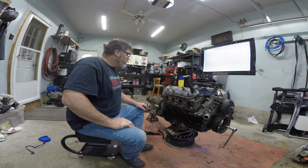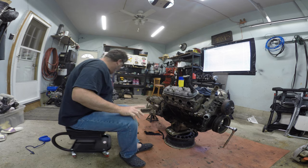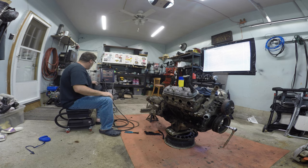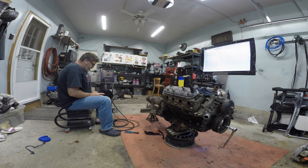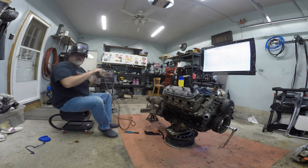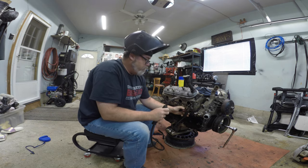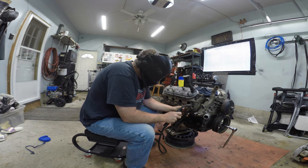What we need to do is weld this stuff on here. Let's give her a wrinkle on the first one and see if we can't get that stud out. I'm not big on the easy outs, so I'm just going to use my welder. We'll give her some power, see if we can't burn it in good. I'll put her right about there and we'll see what happens.